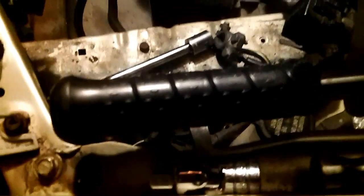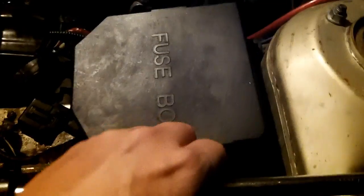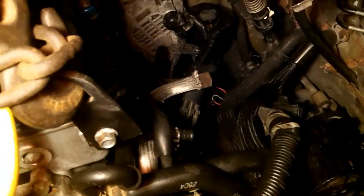And as you can see, that's my 1/2 inch breaker bar, that's my 1/4 inch breaker bar, and that's the length of this 1/2 inch breaker bar. It's much shorter but much thicker, and that was the trick that I needed, because in this space from the bracket to the back of the engine where the intake manifold is, the breaker bars that I had were too long. So that shorter 1/2 inch breaker bar was able to fit into that space, and that's what gave me the leverage I needed. So you need just the right tool for that job.